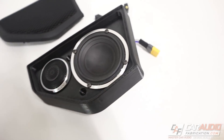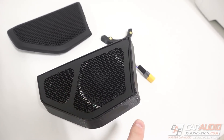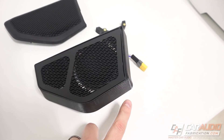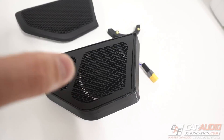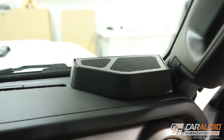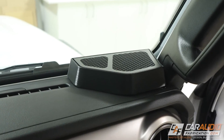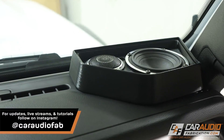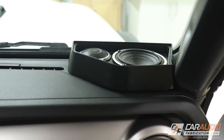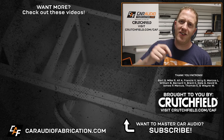When I designed the pod, I added a small pocket on purpose that allows the grill to sit down into it. If you're wondering why it has a sloppy fit right now, that's because I'm going to be wrapping this pod with vinyl upholstery that will come up around that edge and tuck down in — if I hadn't allowed for that clearance, the grill would never fit back in once wrapped. Doing a quick test fit, you can see how it looks up in the dash. We'll repeat all those steps on the other side of the vehicle. I'm really liking the look of this. I post behind-the-scenes content on Instagram — I'd love to have you as a follower. In the next video I'll be wrapping these up and getting them fully installed. If you're new here, I'd love to have you as a subscriber. For your next car audio install, check out show sponsor Crutchfield at the link on screen or in the description.